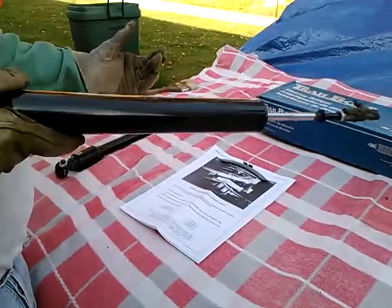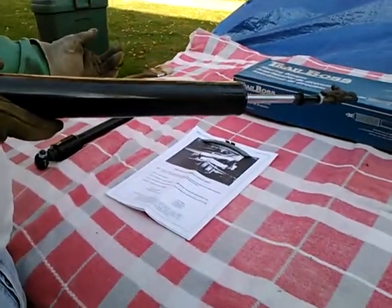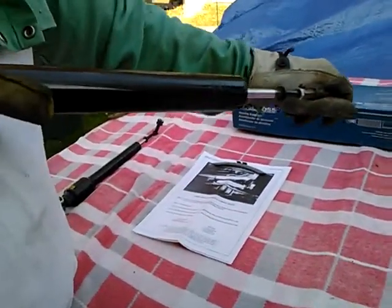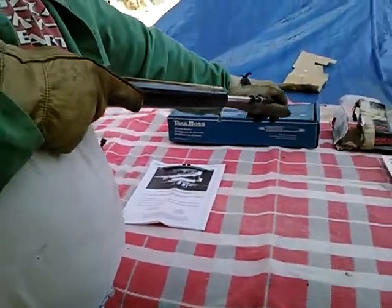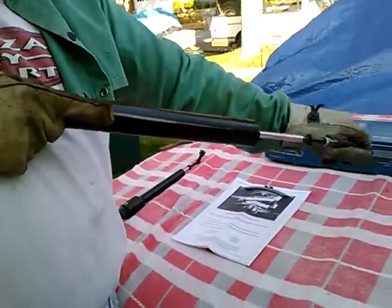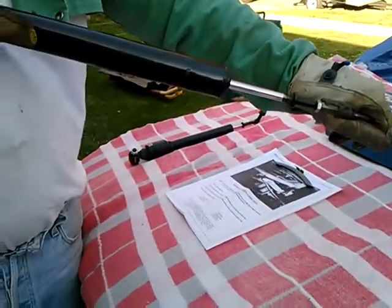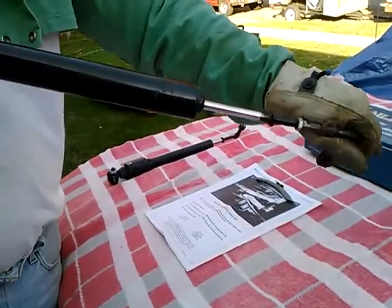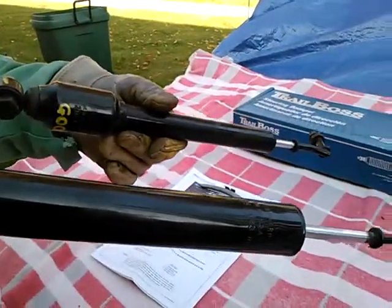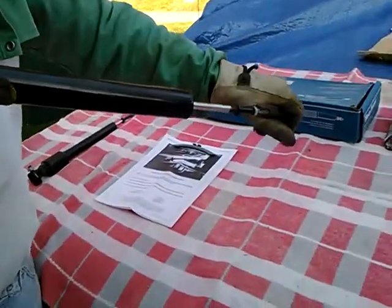The Trail Boss connects to the steering, but I continued to have the death wobble issue. I never considered that this was contributing to the problem rather than solving it, but I finally had to accept that if it's mounted with the reservoir high and the operating rod low, it quickly develops a dead spot. Simply changing back to the stock damper was a tremendous improvement.